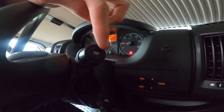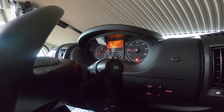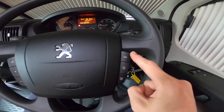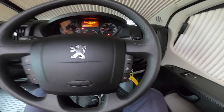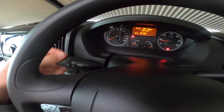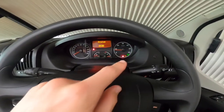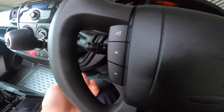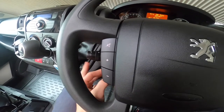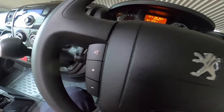You've got headlight adjustment and a wiper stalk with a trip computer on the end — you can view your average and instant fuel consumption, distance travelled, time travelled, fuel usage, and how much fuel you've got left. Press and hold to reset. SRC changes between radio, FM, AM, media, and CD. The other stalk has lights and indicators, and then at the bottom you've got cruise control. To operate: switch it on to get the green light in the dashboard, get your speed, push up to set, push up to speed up, pull down to slow down, and cancel by hitting the end of the stalk or the foot brake. To resume, press the end again and it'll set itself back to the last speed set — if the engine has been turned off, push it back up and set the speed you want.